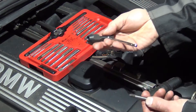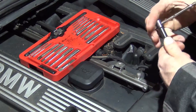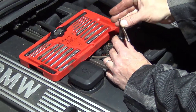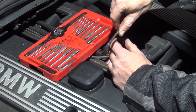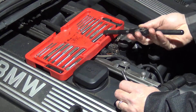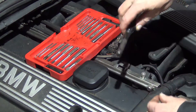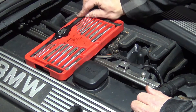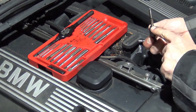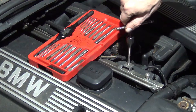There are a couple of different tools you can use. One is this style — it just goes in, you tighten it down to lock the tap in place, and you can slide the handle to use it as your turning tool. That's nice because you can move it around to get into tight spots. The other tool is a larger handle style — it has a square edge that catches the tap. For this repair, the smaller one is going to be the right one to use. Once it's in, you just gently snug it down — you don't have to go too crazy because it locks on all four corners. Try to square off and make sure you're starting straight.